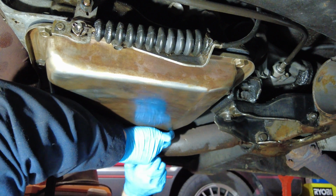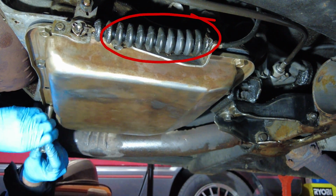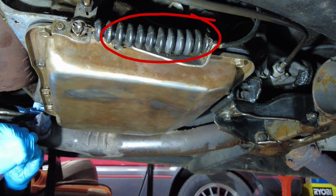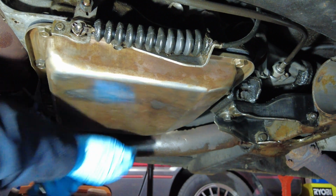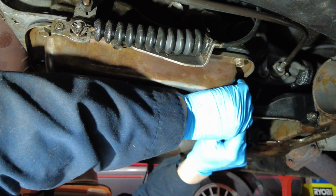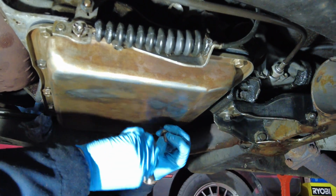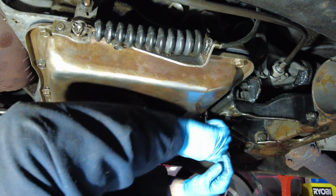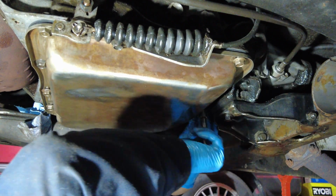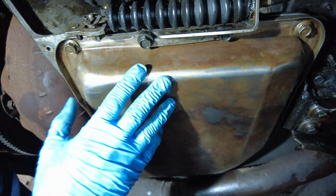The two bolts that are used for where the transmission linkage is, those are the two bolts that have the separate washer, and if you look closely, they're also a little bit longer than the other 11. So it's important that you stick those two bolts with the washers specifically on the transmission linkage area. You can see there's a metal bracket for the linkage, and that's why the bolts are longer, so that you can get a full length of the bolt to cover the bracket and then into the transmission. So there we are right now.